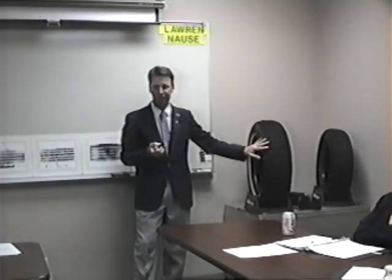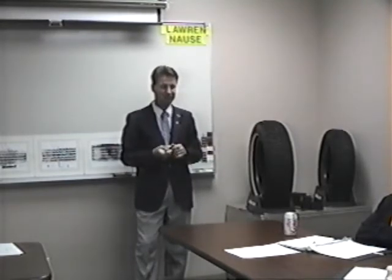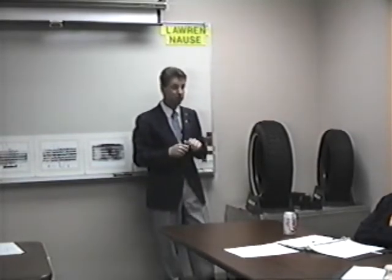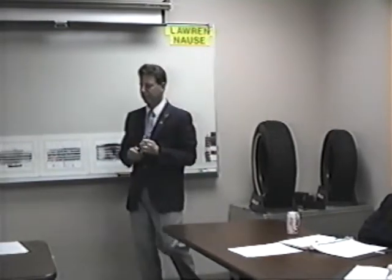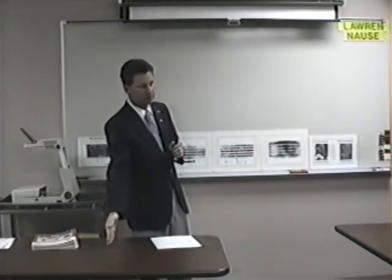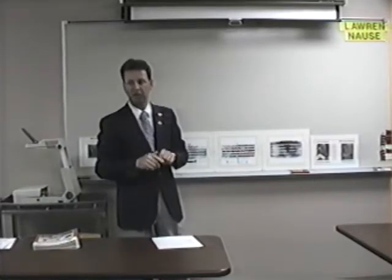As this tire wears down, it gets really hard to pick the edge sometimes, the outside edge. So that's the problem with going edge to edge. What if you happen to have a tire that's really worn like this on one side and fairly sharp and clean on the other? You're measuring edge to edge. It could introduce a small error. But it's usually possible to pick the very center of the pattern. Even if you just stand back and use a ruler after you've done your photographs and go down and place it visually right in the center, you'll probably hit dead center because your eye is pretty accurate like that. But whenever you've got a groove right down the middle, it makes it real easy, or a rib right down the center. You just pick the very center of that rib.